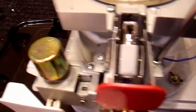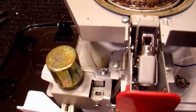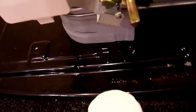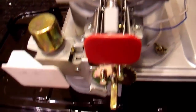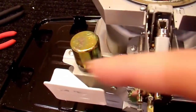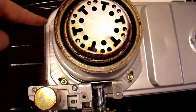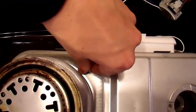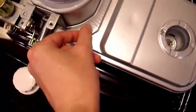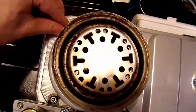The extinguish button pops the wick back down. For the igniter, there's a couple of screws — one on that side, one on the other. We take both of those loose, then take this screw up here loose, and we can take off the draft stack and the ignition. It's just screws — you take them out and it comes apart. With those pieces out of the way, there are now four wing nuts that hold the whole assembly down to the tank. Take all four of these loose — you may need pliers in there — and then pull the assembly out.